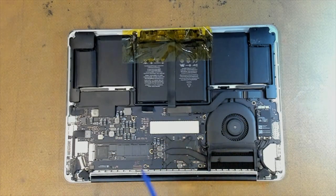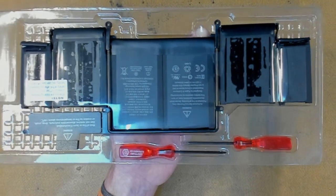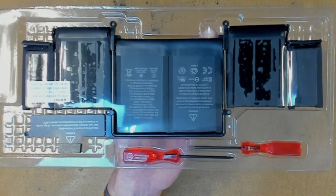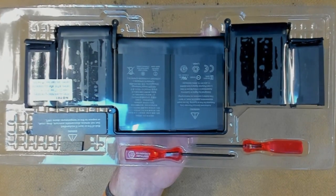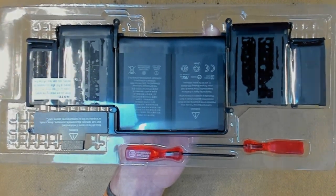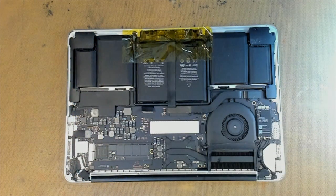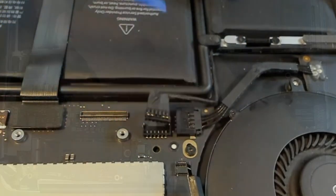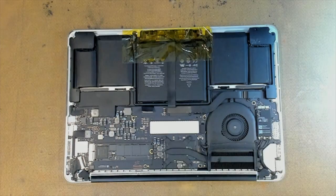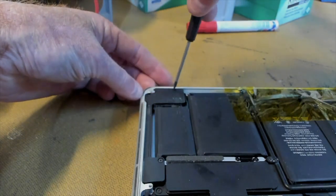We need to remove our logic board and battery. Be aware when you take out the old battery, you have to replace it with a brand new battery — because Apple sticks the old battery in with double-sided tape and makes it nearly impossible to take out. There's even a slight fire hazard if you accidentally puncture one of the cells. We're going to work our way around the MacBook in an anti-clockwise direction, taking out all the screws, detaching plugs, removing the logic board, the daughter board, the battery and all components, bringing it down to the keyboard level. We'll get our T5 screwdriver and remove the speaker.